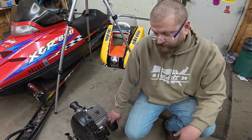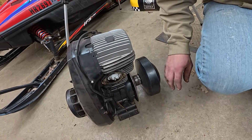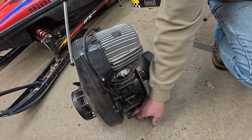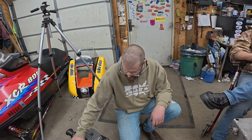All right, we're discussing other ideas here. What do you want to do, Greg? I'm thinking if you just slot this out, cut it out on both front and rear, put a big strap or washer over it, and then just oblong this hole and this one on the front side. It's not going to go anywhere. All right, that's probably the plan. Are we even going to unbolt it off the motor, Greg? Well, we can. We'll just tip it up. Four bolts. All right, we'll get that thing off the motor and we'll have at her.